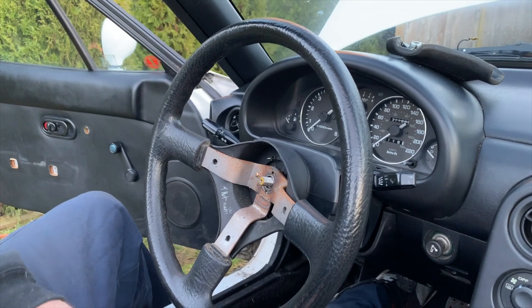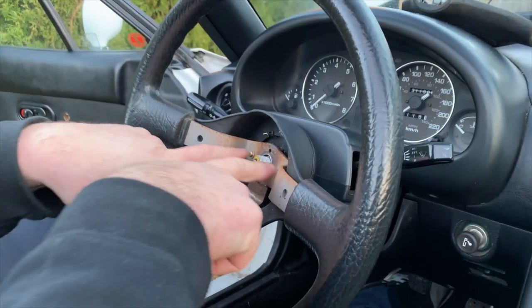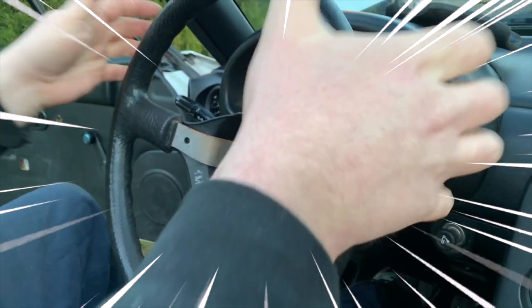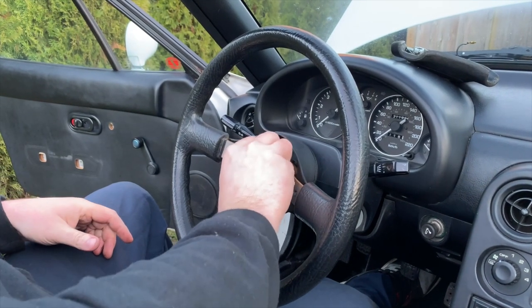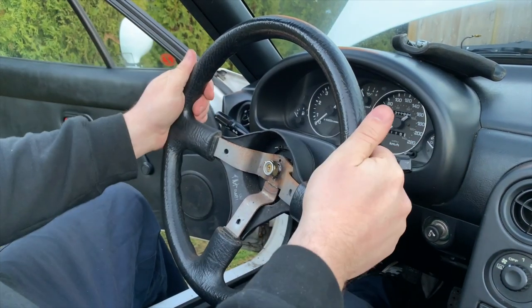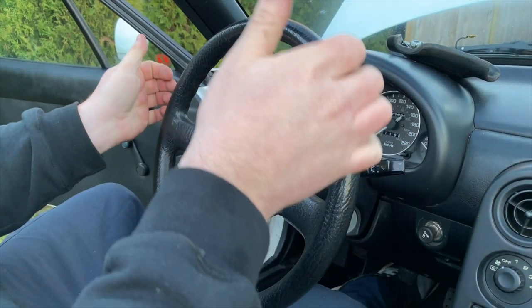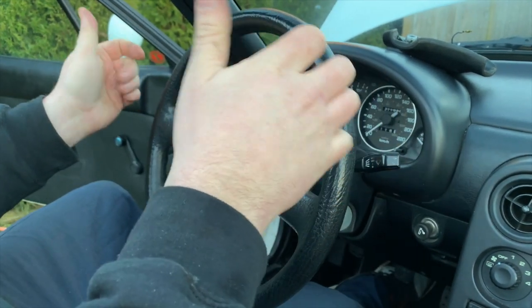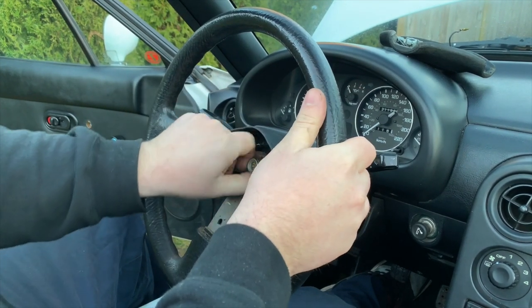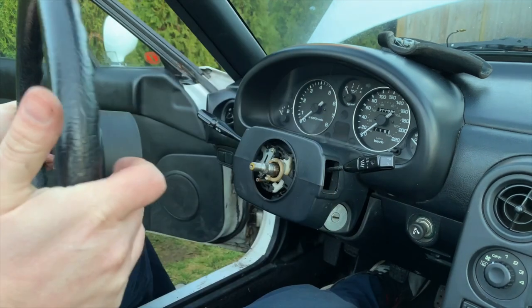If you have what's called a steering wheel puller, you can use that puller to push the steering wheel off the center steering column. A lot easier way is just grab onto the wheel. Once you've knocked it around a bit, put the nut back on so that you don't end up pulling this wheel right into your face or your chest or something. Very common to have that happen. If you put the nut back on, you'll only pull it as far as the nut. So there, steering wheel's loose, pull the nut back off, and the steering wheel slides off nicely.